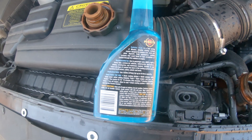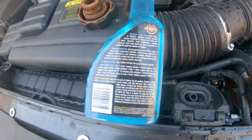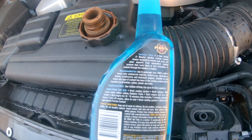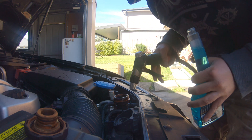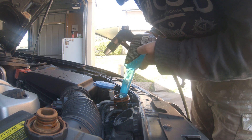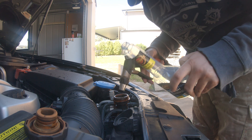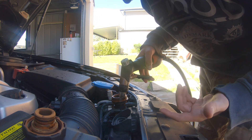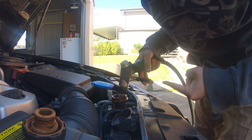One bottle does up to 15 litres. We'll follow the instructions: drain the cooling system, refill the radiator with clean water while adding the radiator flush, start the engine, turn on the heater, run the engine for 10 to 15 minutes, turn it off, allow it to cool, then drain and refill with appropriate Penrite coolant. This stuff is designed to remove rust, scale, and deposits. I'm going to run the car without the radiator cap on initially, allow the thermostat to open, then top it off and pop the cap back on so the system will pressurise and circulate everything through.